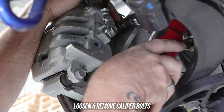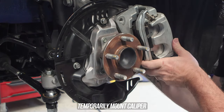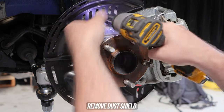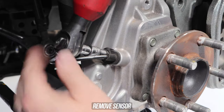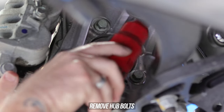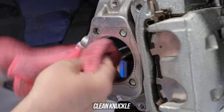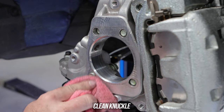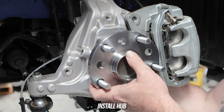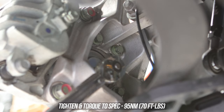Go ahead to the back of the brakes and zap off the two main caliper bolts. Pro tip: if you don't have a zip tie or coat hanger handy, you can remount the caliper to the hub while we do surgery, which is what we're doing here. We need access behind the knuckle, so remove the backing plate by zapping off the three bolts securing it. Loosen and remove the bolt securing the sensor to the knuckle and safely place that out of the way. Then head to the back side of the knuckle and remove the four bolts securing the hub, remove that hub, and get it out of the way. Wipe away any debris from the area in preparation for its PCD reassignment surgery.